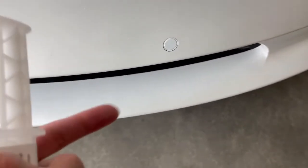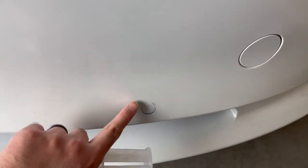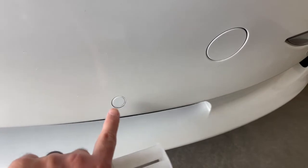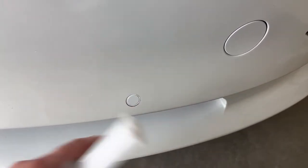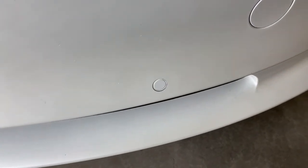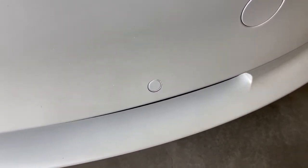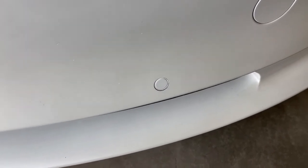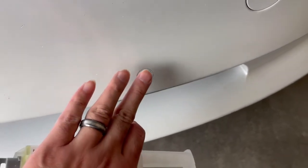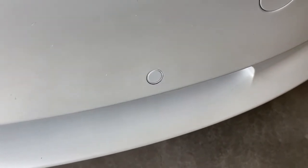Get gloves first, then you put some on your finger and reach down and paste it on the opposite end of the bumper around this area. Then put some within the circular area and grab the sensor and shove it in. You essentially try to hold it there for a minute or so it cures and settles. I sat there probably for a good four or five minutes. So this is the next morning and it seems okay — I don't want to push too hard but it seems like it's going to function okay.